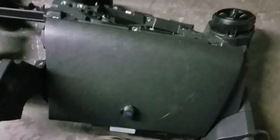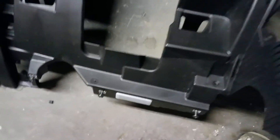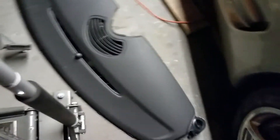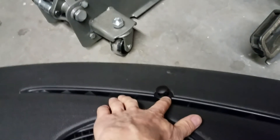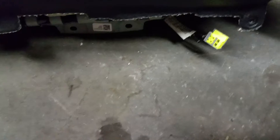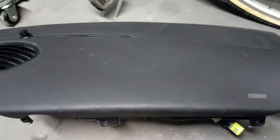There's not much electrical on this piece except for two connections in there and one there — kind of like courtesy lights that come on when you open the door. Under here is the dash, and there's one connection — I want to say that's for the light sensor, but let me know if I'm wrong. Under here you've also got your airbag connections. The dash pad mounts with a couple of screws right there and on the other side, plus some hidden screws inside with little covers on either side.